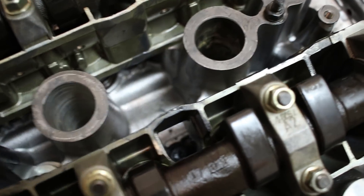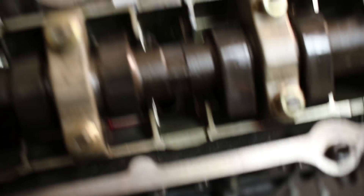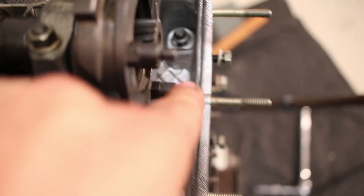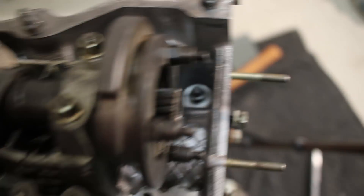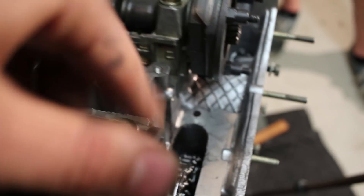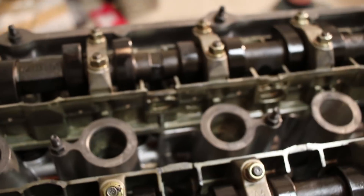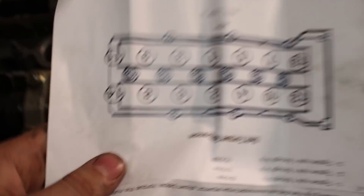There's some deliberation — struggle. Deliberation sounds better. All the nuts are on and have a light joining torque. Even these little bolts are in the holes — I got those brand new just because they have a tendency to strip. Those are all in the description along with everything else. Now here's our torque sequence from ARP. We're just going to torque it down — cue torque montage.